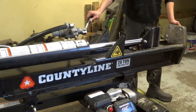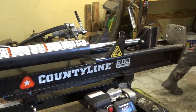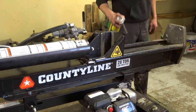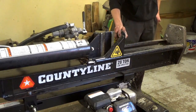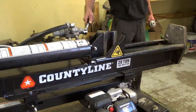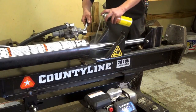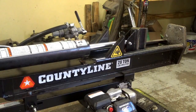Good movement, although these are god-awfully slow compared to a flywheel-style log splitter. We're just going to move everything down with some spray lube — that helps all the wood chips kick out from between the rails instead of getting jammed in. It makes everything run a little smoother. I lube my log splitters up after I'm done using them every time; it also helps the worn paint surfaces keep from rusting out.